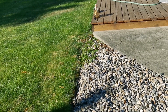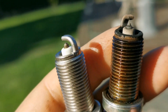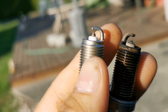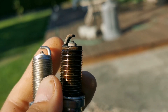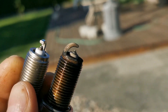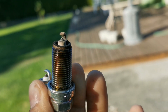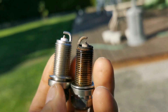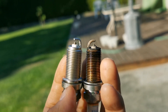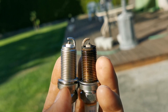Compare the gap between the electrodes of the new one and the old one — the gap grew a little too much on the old one. It's a very expensive spark plug, but time will just make them wear out. This car also has oil on the thread of the used spark plug, telling me the spark plug may not have been properly torqued. Make sure you do it properly — don't tighten it too much or you will break the weak threads on the aluminum head.